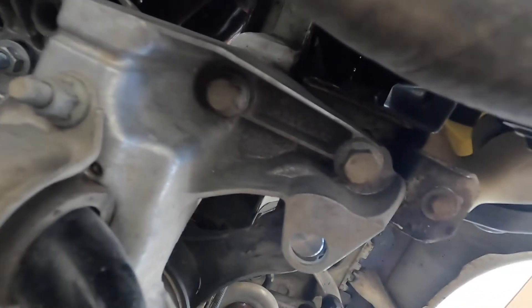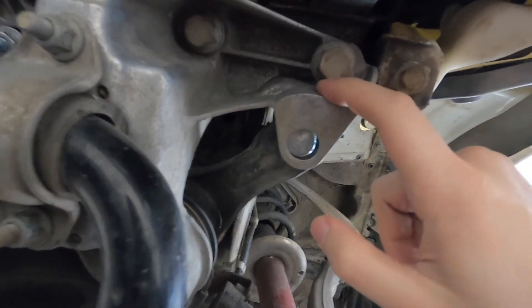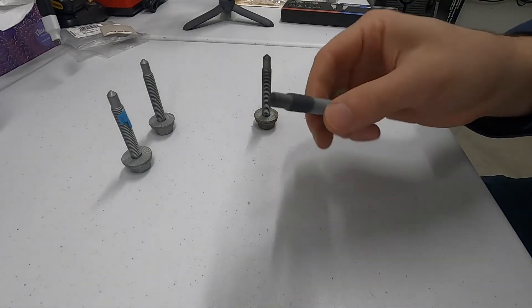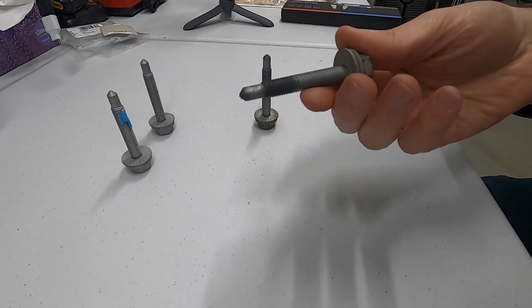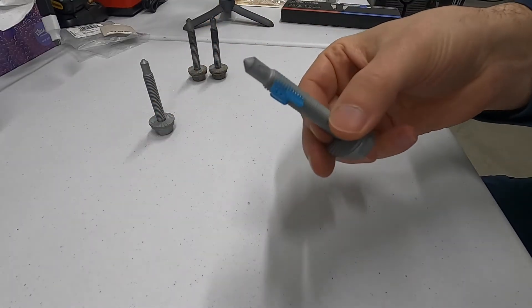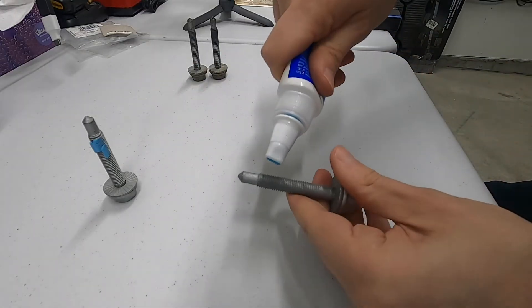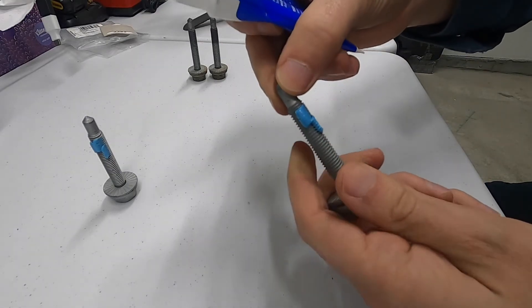With the motor suspended, grab your 18mm socket and break loose the front two bolts, then the rear as well. At that point everything will be loose and you're ready to start aligning. Because I'm replacing my hardware, I'm taking these out entirely, putting the new ones in about 95% of the way, then doing the same in the back. I just had one of those moments where you're expecting to break loose something at 50 or 80 foot-pounds, and it comes out with almost no effort — which is really scary. It means there's been vibration under the car since the motor mount job, and these old bolts were not torqued at all. So I'm putting blue thread lock on the new bolts — trying out this Permatex medium strength gel-based thread lock. The gel is a bit thicker, doesn't run or drip through the threads, which I really like.